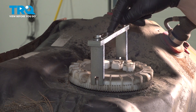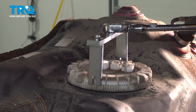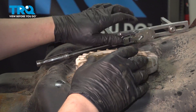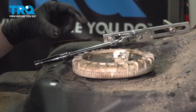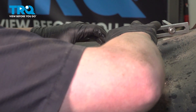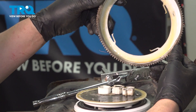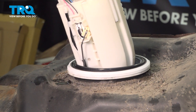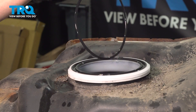We're going to use a fuel pump ring tool to remove the fuel pump retaining ring. As you're removing the fuel pump ring, you're going to have to push down on the little tabs as they go around the fuel pump so you can remove the ring. Remove the fuel pump.